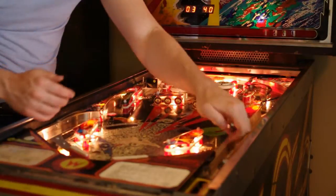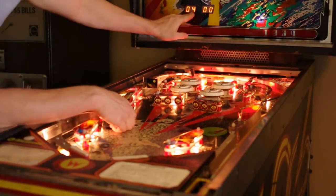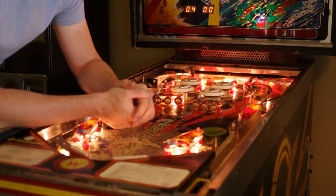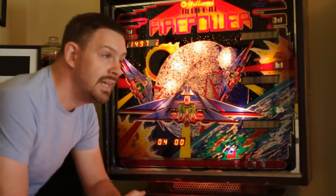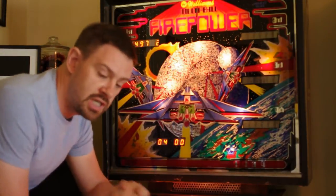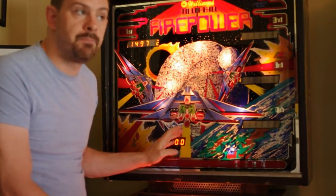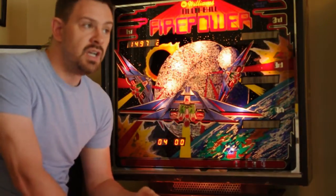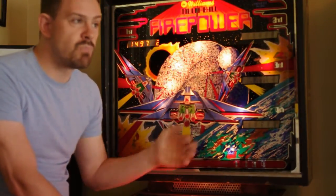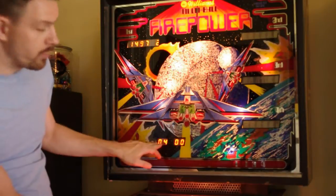The last thing we're going to move into is the audit setting, which is probably one of the most confusing ones there is. I want to back up and show the whole back glass to give a better explanation. This right here is the infamous audit mode. It tends to get a bad reputation because if a machine powers up and does not boot into game mode properly, a lot of times it'll boot into audit mode. That's actually a good thing to see because it means your machine software is running — it's just not maintaining your settings. If you see this coming up a lot when you power on your machine, more often than not it means it's time for new batteries on your CPU board. Here, 04 means your audit mode.